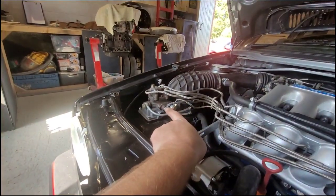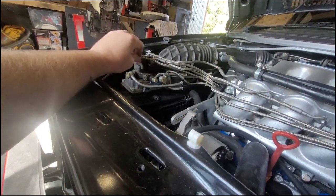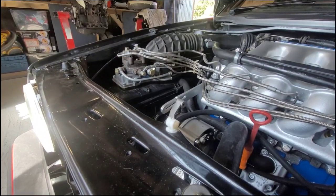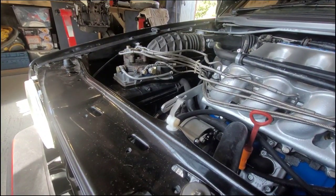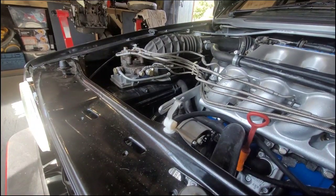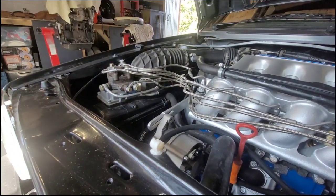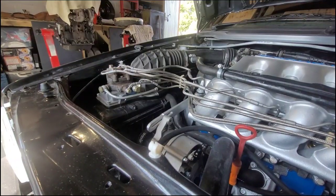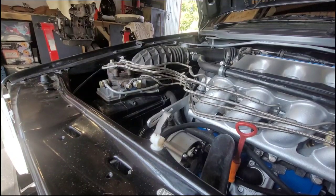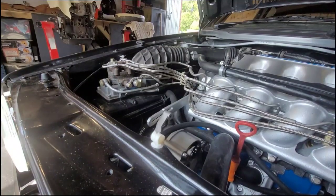So the metering head, I'll have to get another one of those and I will probably send it away to KMI Injection, because they are the best in the business at doing it. Unfortunately, it's 420 quid and about 10 weeks, but hey-ho, they ultrasonically clean everything. I might put my hand at it and try it myself. I mean, it was working, just not perfect. Who knows what's wrong with it? They're notoriously temperamental. They're easy to take apart and put back together, there's not a lot to them, but there's probably a little bit of dirt somewhere. So, hey ho, we'll bite the bullet and get that changed at some point. Like I said, we're running now, so we're not worried about it.